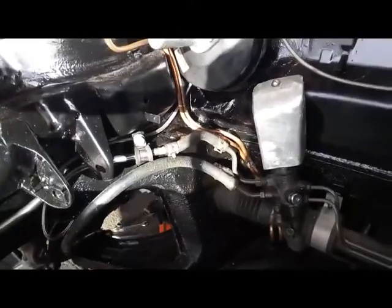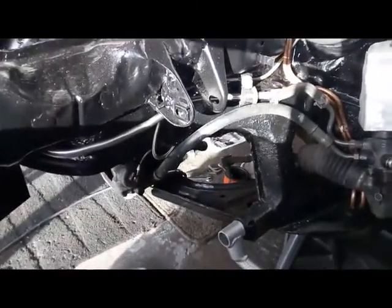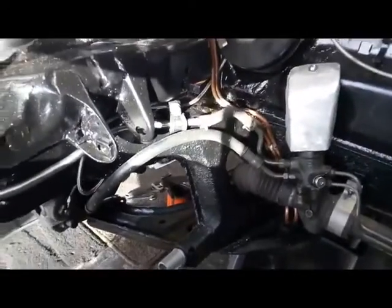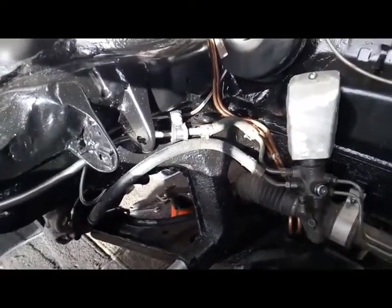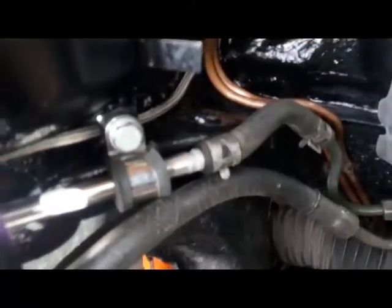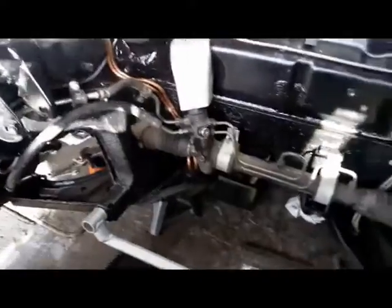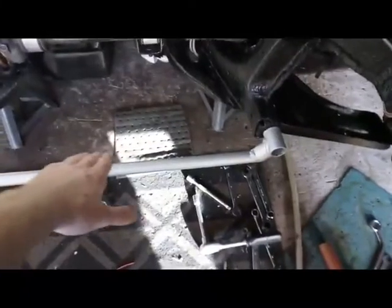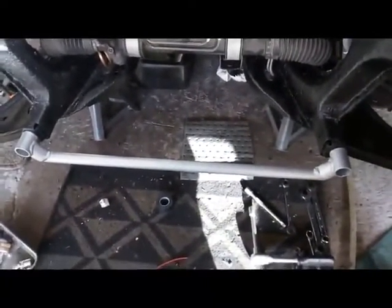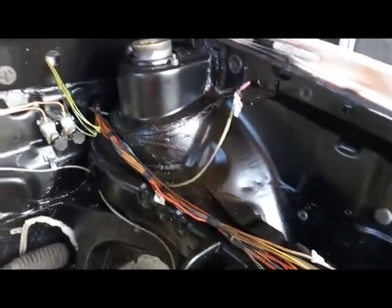Just as a point to note — if you can use the Toyota Starlet pressure pipe, it fits onto the Volkswagen power steering pump no problem at all; I have it done in my Sirocco. I'm just offering it up for length and it looks pretty good. I've got the pipes welded up and I'll just puddle them in with the TIG torch, letting them melt together. I've also got the cross-member bar cleaned up and given a fresh coat of spray, and the engine base is sprayed up just to keep it clean looking.